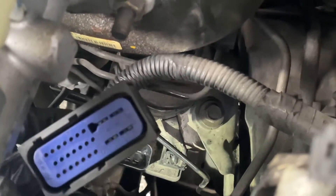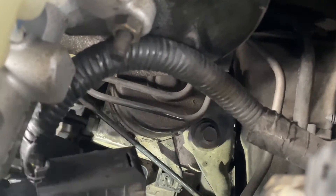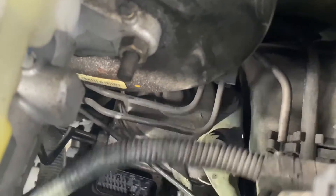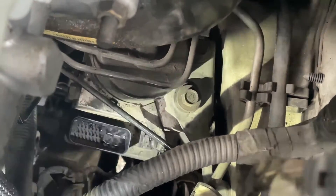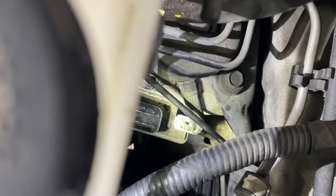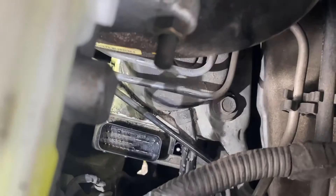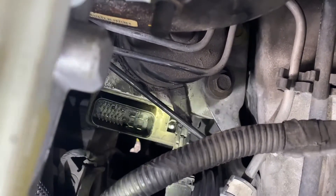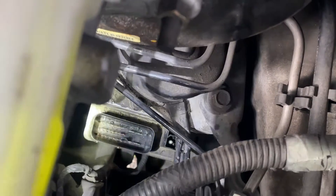So those terminals allegedly — there was rubber. The recall's rubber was missing from the sealant, so I'm guessing it's on the backside. Every terminal has rubber going through it. I'm not de-pinning that. And there's one other connector next to it — just a little two-terminal. Yeah, there it is, looks white. It's so bright. And this one, of course, the terminal connector broke, so it's just sitting in there. But it's still pretty tight. Those are like big terminals. They don't look moisture-ridden to me. Yeah, they look pretty damn clean, but I'm just going to spray everything down.